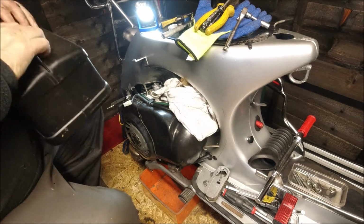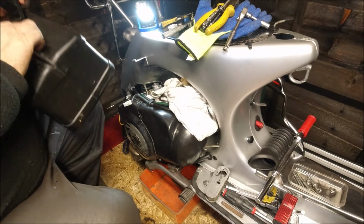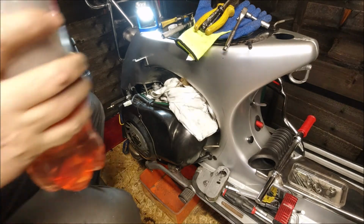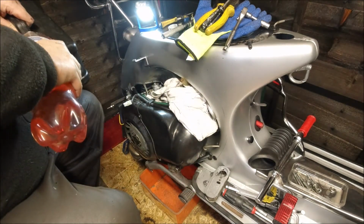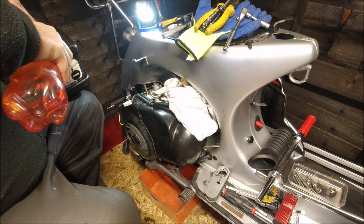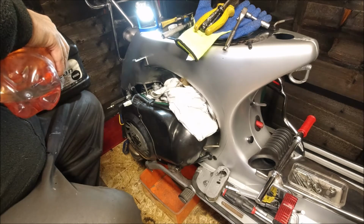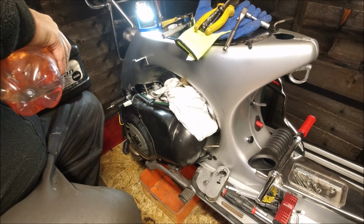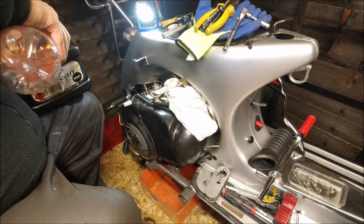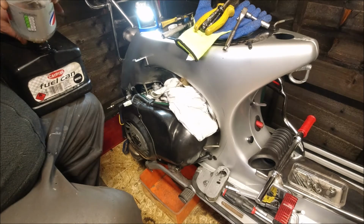Right, I've just got back with an empty petrol can, which I'm going to just distill. You can see the colour of it, it's running 4%, which is no good in a PX. Fine for a GS, no good for a PX or any 2% Vespa. Hence everything being black on my previous video before I cleaned the piston up and the cylinder head.